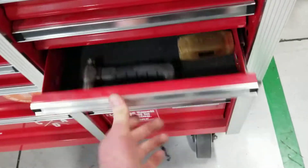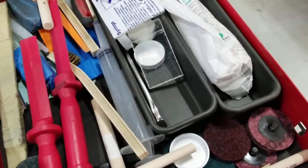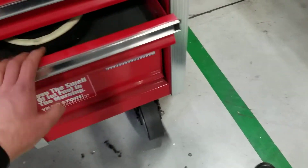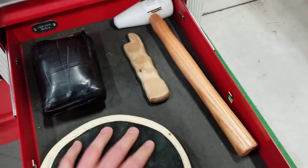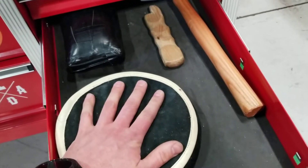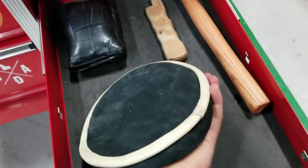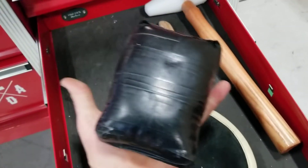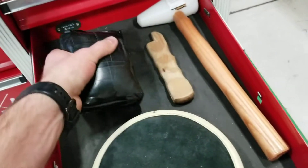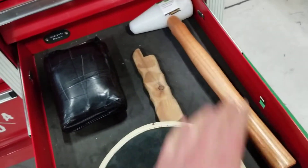Hammer drawer — nothing big there. Kind of another messy drawer, but random scrapers and brushes and stuff when we're doing painting and getting rid of sealant. This is stuff I keep for cold working in here. I have about a 25-pound lead shot bag — it's great for cold working dents and stuff. And then I've got a smaller one here, a little bit more compact, that works really well for pin dents. And then a piece of wood for cold working and a hammer.